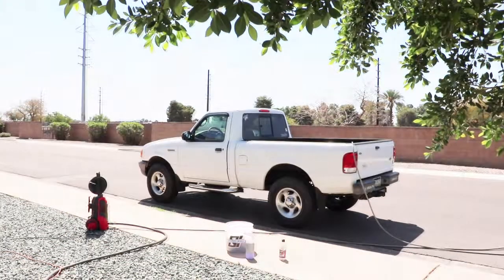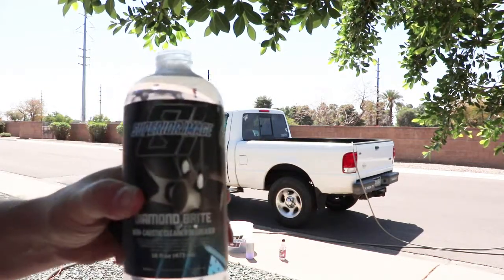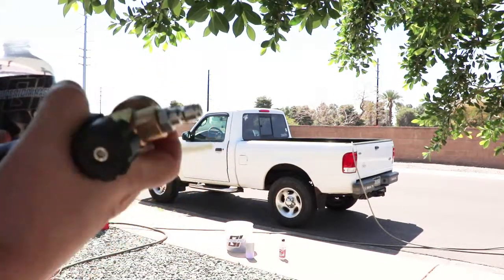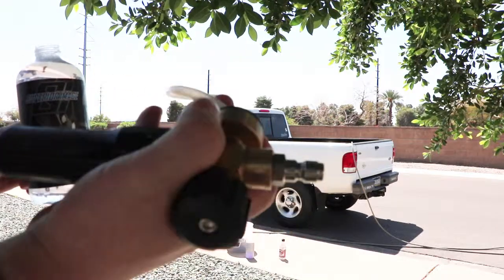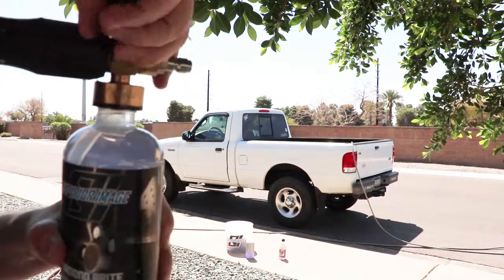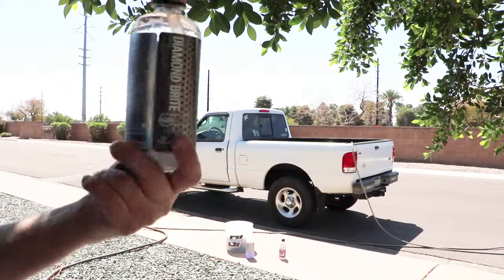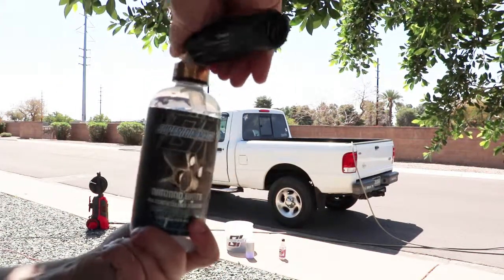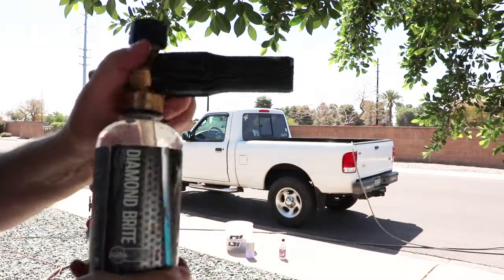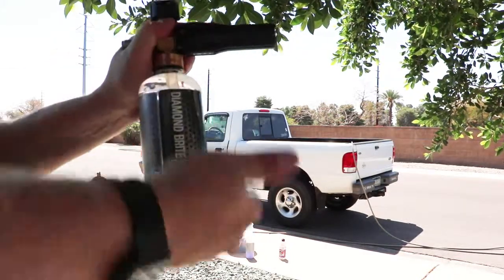So enjoy. Hey, for those of you wondering how I'm going to get this product onto there, am I going to have to keep refilling and emptying and washing out that bottle? No. See, the hose for the spray nozzle on the pressure washer is a rubber hose. So you're just going to stick it down in there and let it twist around in. Keep twisting till the lid is tight. We don't want it to gush out. This is a full bottle. And there you go. You actually have your pressure washer and your product feeding.